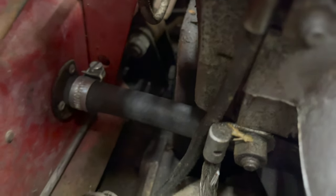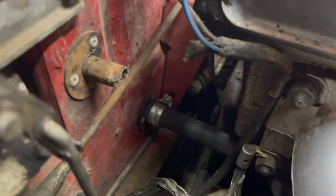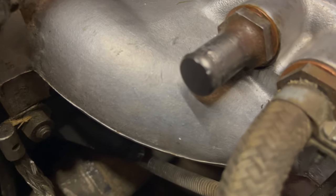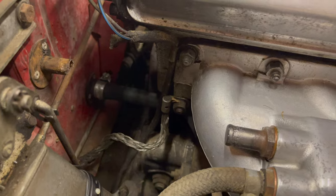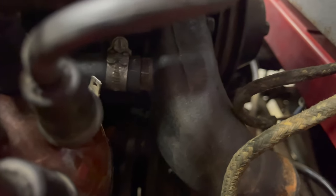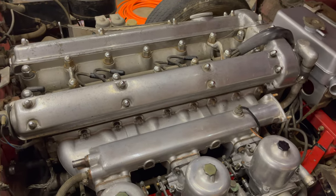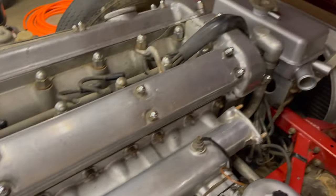This pipe for the heater is not looking too good, and the other one looked the same - god only knows what's going on in there. So I cheated a little: I took another set of these fittings and welded a little bung in there, welded shut, so no coolant is going into the heater system or into the bulkhead for now. There's also another welded-shut bung on the back of the water pump, so the heater is completely blocked off for now. I can only handle so many things at a time.